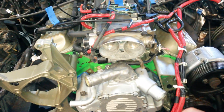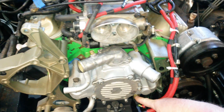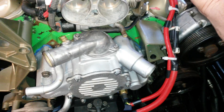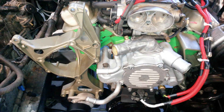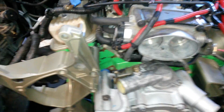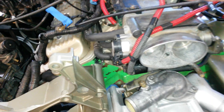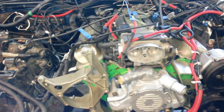I've got the crank sensor in there. The thing is I have to use two service manuals to figure out the color coding — there's a water temperature sensor on the Chevy and I have to tie that in to the temperature sensor wiring on the rover. The red and black wires were to help me differentiate. I still have a few things to hook up: the air conditioning compressor and belt, a pulley system, a canister solenoid, the manifold absolute pressure sensor, and the idle air control valve.